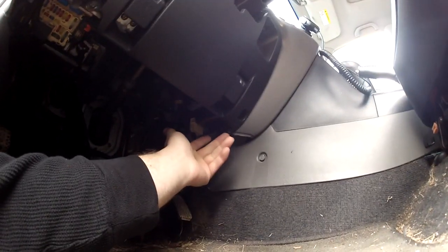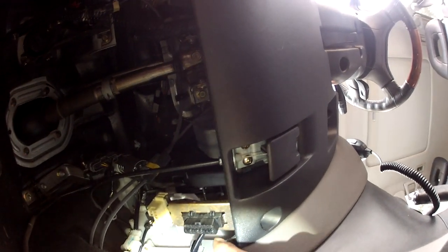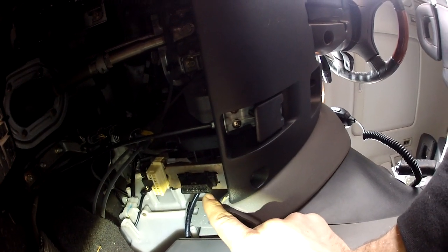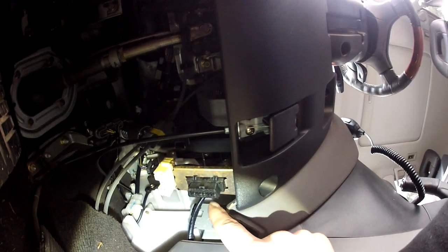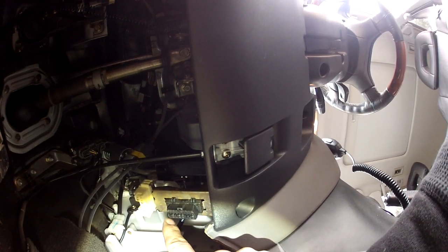In order to find pin one — I've been doing this so long I know where all the pins are. One end of the connector is narrower than the other end. On the wide end, there's a one and an eight marked on it, showing you pins one through eight. On the Monteros, pin one is going to be closest to the driver. Pin four is literally the fourth pin over. Pin eight is an empty spot, so if you're on the wide side and there's no pin in there, you're probably at pin eight. You can do it with a paper clip or just put a wire in there.